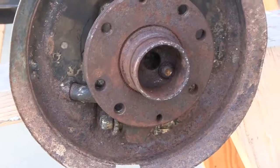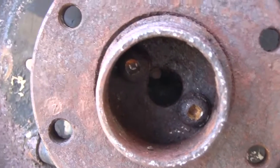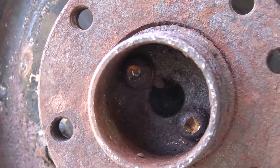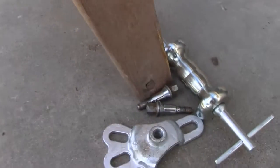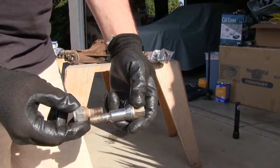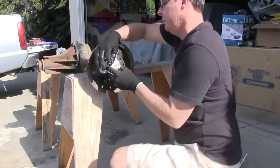On the left side of the car, this was a little different story. I couldn't get the little hub piece off because these screws are just rusted in good. Still using the puller, but the factory lug is too short to put the adapter on. So I've got these other lugs from my Hayashi racing wheels — the threaded portion is longer — and that's what I'm going to use for the left axle.